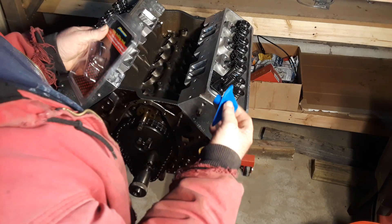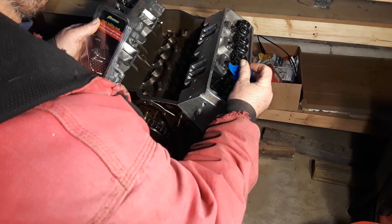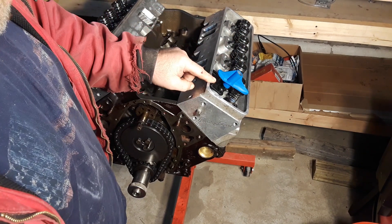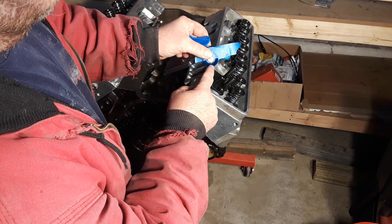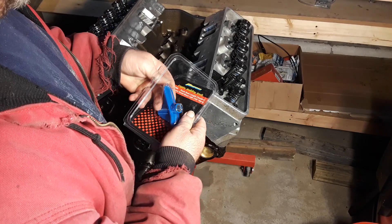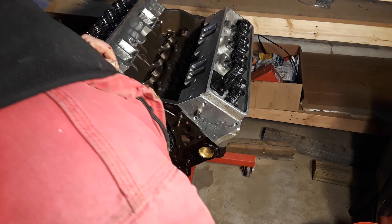They're actually both rollers, but what you put on the trunnion — we put that on there and we've already determined what our height needs to be, and it's not even getting there. If we went down to where it needed to be, our rocker arm hits on the head stud. So evidently this is no good for this engine — piece of shit.